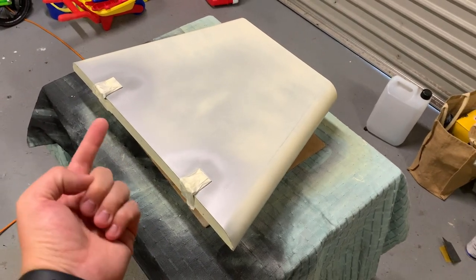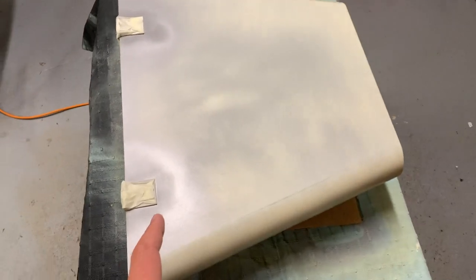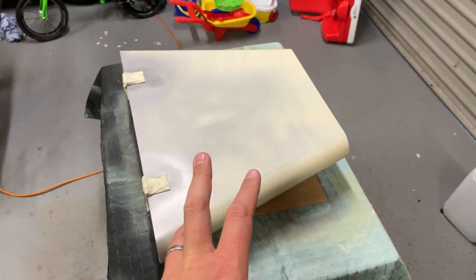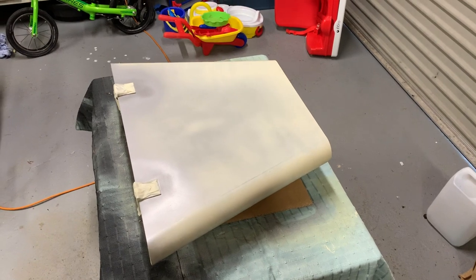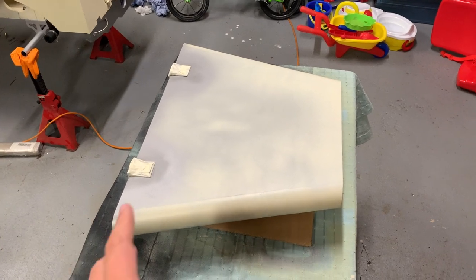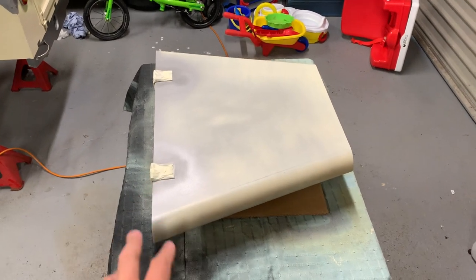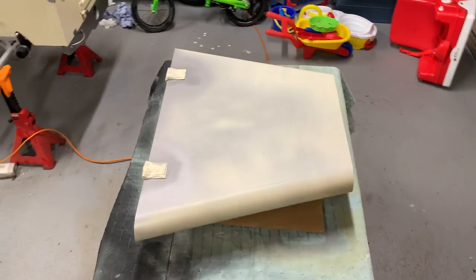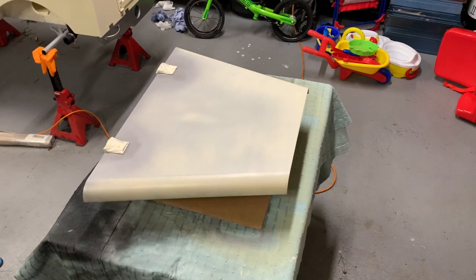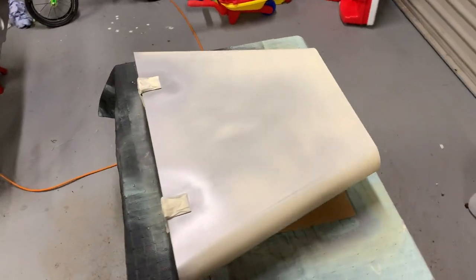Having done a quick jump forward, it's all painted underneath and I've turned it over. Having lacquered underneath - and previously I had painted the hinges silver already in preparation, but then I ran out of cream and coronavirus happened so I wasn't able to get any paint mixed. I've taped up the hinges to keep the silver protected, then I'm going to do all the cream limestone, take the masking off, and then lacquer it all as one so it should be nicely sealed. I've degreased this multiple times with white spirit, used baby wipes and white spirited it again, wiped all the debris off and it's been sanded - really hoping for a top-notch paint finish.